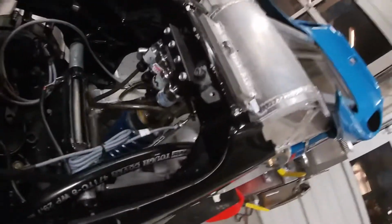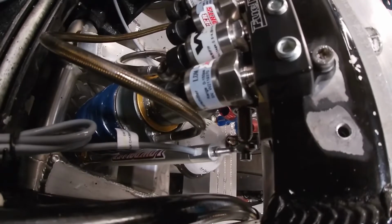The shock sensor is mounted. So what I did right here, if you guys can see, I tapped the end of the bolt, and I put a bolt right through it. It was an M4 by 0.7, I can't remember. And on the bottom, obviously because these bars to support the swing arm were in the way, you guys are gonna laugh, but if you can see right here, I actually found a 1/2 inch NPT brass plug, and I drilled and tapped it to fit. So one side would actually bolt threads to the bolt, and the other side is just tapped to take the bolt that's M4 by 0.7. It works. I'm pretty sure it's going to be strong enough.